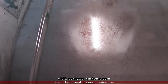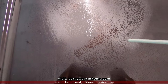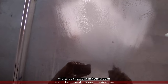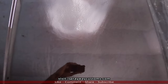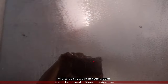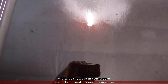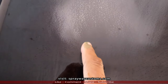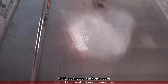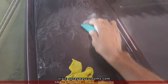I'm going to get the blower so I can blow it off so it'll dry a lot faster. Now we can see the orange peel a lot better. I don't see any area that's flat like I wanted — maybe right here. We need to get it all like this here. So I'm going to continue, and once I get it like this in this spot, I'll cut y'all back off.